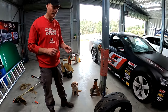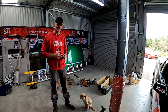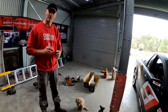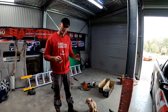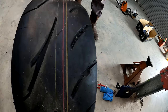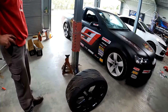What's next? We've got to take her into Jack's and get our wheel alignment done - probably put in a couple of degrees negative camber and a little bit of toe, like we did last time. I don't think we'll go too aggressive - four degrees might be too much for this ute. We'll get advice there. Not sure about a sway bar yet - maybe a Whiteline adjustable front sway bar. Then get the green off these semi-slicks and go testing.